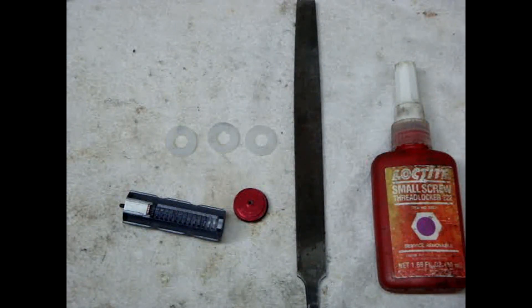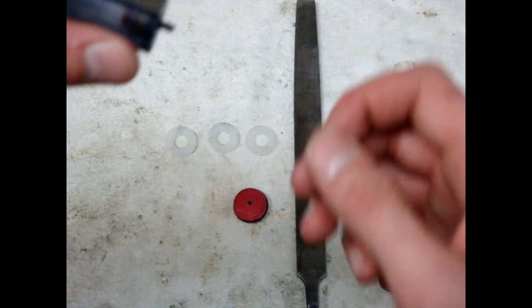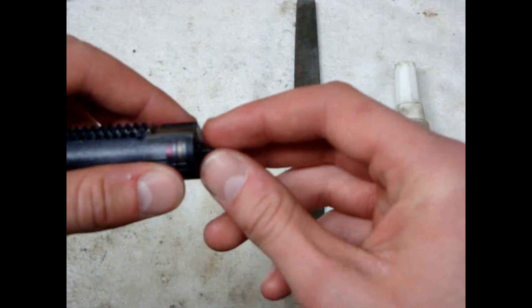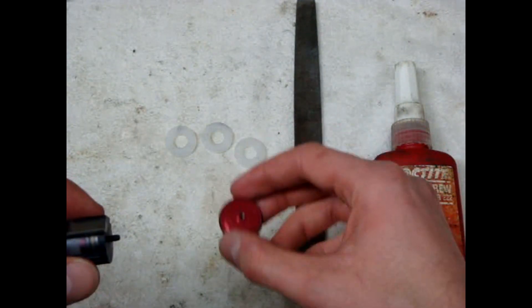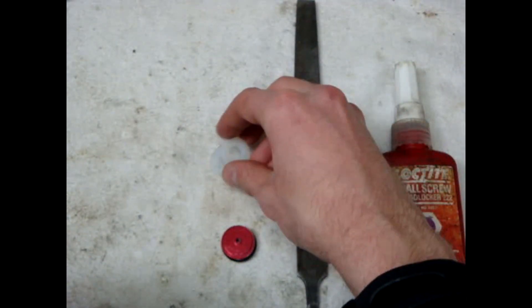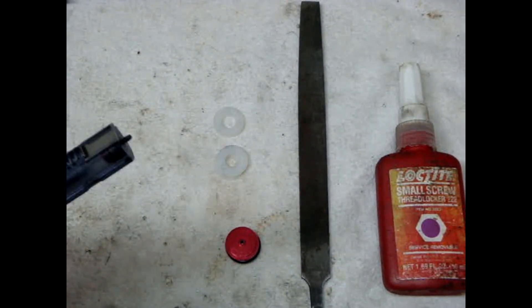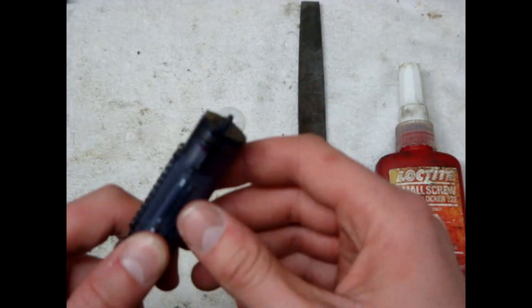You'll need a longer screw for your cylinder head bushing. What I used is a gearbox screw, fine thread — basically whatever you had in your cylinder head, just longer. Long enough to support these three washers stacked together.